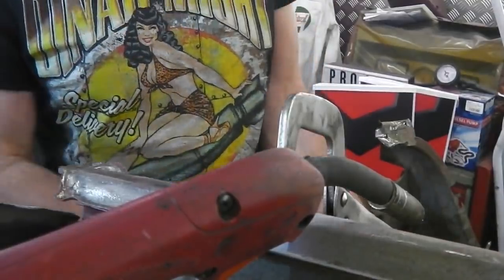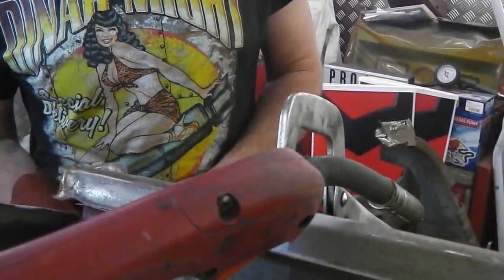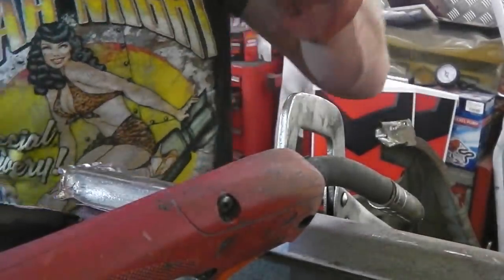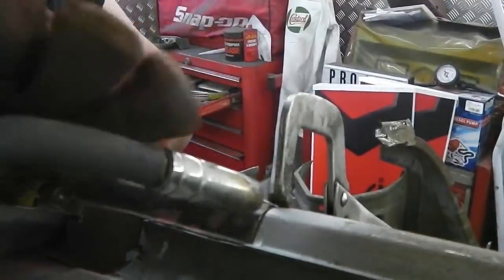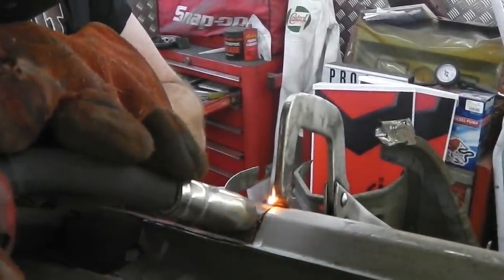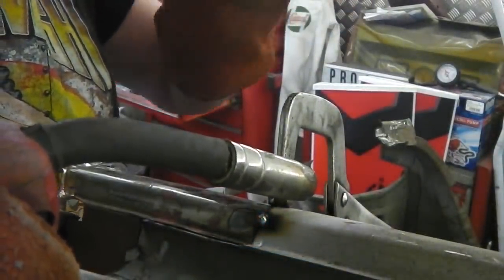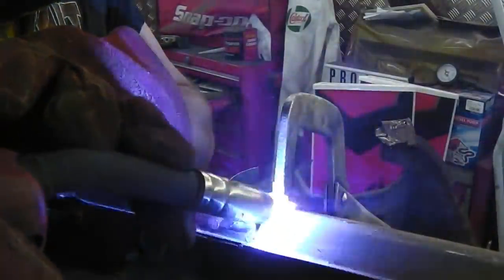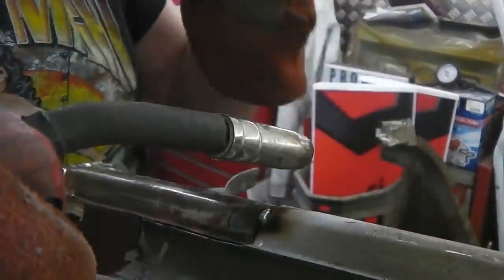Gloves, one pair off, can't quite get double gloves on, so they'll come off, welding gloves on, power's set where we want. We'll just get a tack on first so I can release this clamp. There's a clamp, you just see the C-clamp there. I'm going to come in just behind and just in front of your lens. A little bit of paint on it, just stopping it from first taking. Let's just hope that seam sealer doesn't reignite. Release that. You may as well stay on with me then.